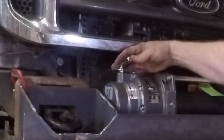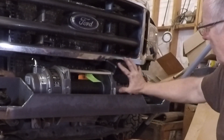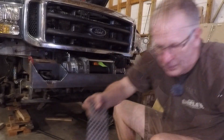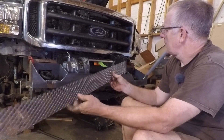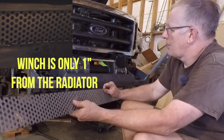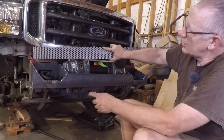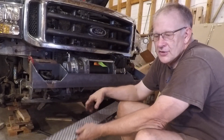I have just enough room to change the clutch drive. The winch control actually bumps into the bracket a little bit, but I've already rotated it forward. There are some cables on the backside that need to be lengthened or loosened. I'm pretty happy with it. For protection, I'm going to build a grill behind the winch and in front of the radiator using a piece of 16-gauge perforated steel — to protect the radiator from any rope wrap drawn into the winch. It'll be a combination of three-quarter square tube and this perforated steel, welded in and reinforced.